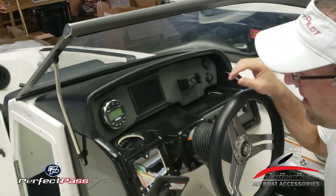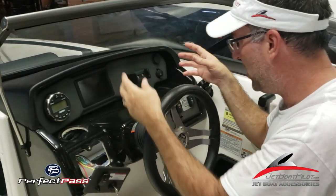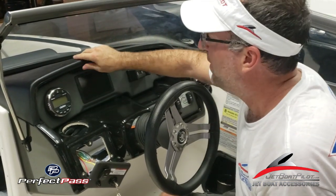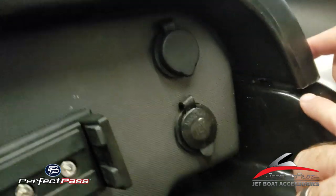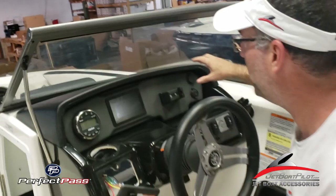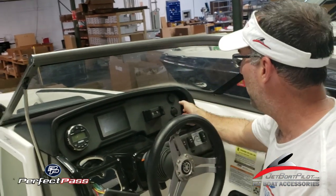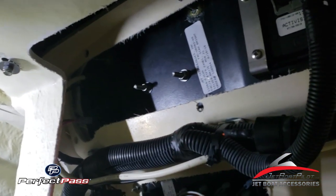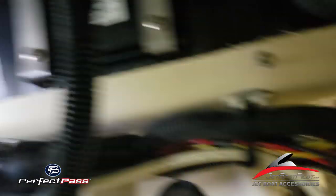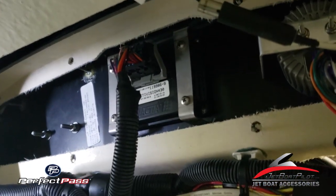In the dash, to pull this off, there's probably eight or ten screws on the backside holding it to the fiberglass, and the same little nine-millimeter nut. Pulled all those off, and then in order to get it loose, we had to loosen the brow — there are four bolts holding it down, plus one Phillips-head over in this corner. Underneath inside the console there is a Phillips-head screw holding this down. So once you loosen that Phillips-head screw and those four nuts, the brow loosens and it lets you pull the dash out. Once you get the dash out, we'll pass this wire around.